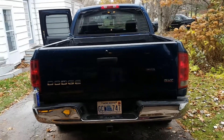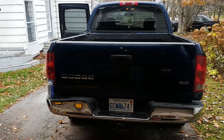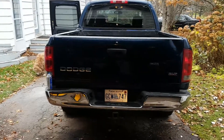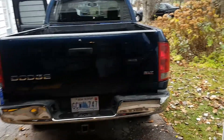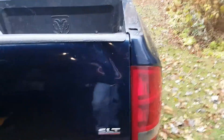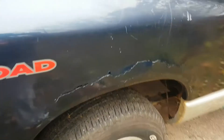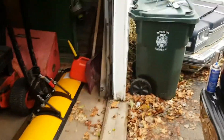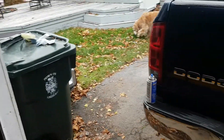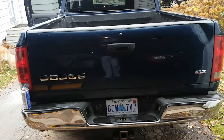It doesn't last by any means. Like I said, that's how I fixed those wheel lips — I just beat all the heavy rust out with a hammer, molded the whole lip, smoothed it, filed it all out, and sprayed it. And it held up until about two years ago when it started to blister out, and then it all started to crack and break apart.